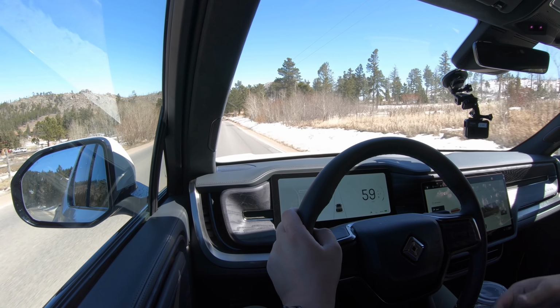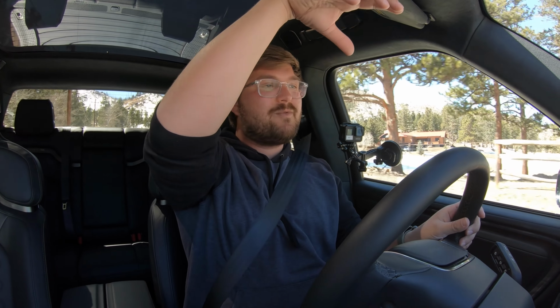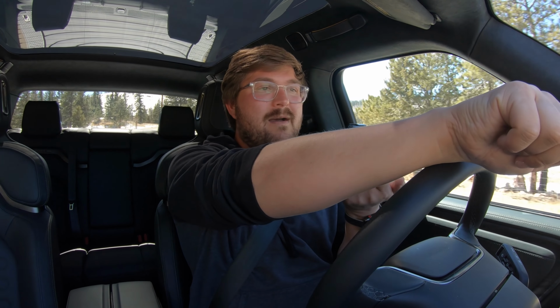It's very difficult for an automaker to tune 2 motors, let alone 4, because of actually just controlling difference in axle wheel speed on a split mu surface. So if you have a really grippy surface and a really not grippy surface, it's quite time consuming to tune your drivetrain to back the front off, but then juice the rear a little bit to keep the same level of acceleration, but from different motors. I can't imagine doing it with 4.